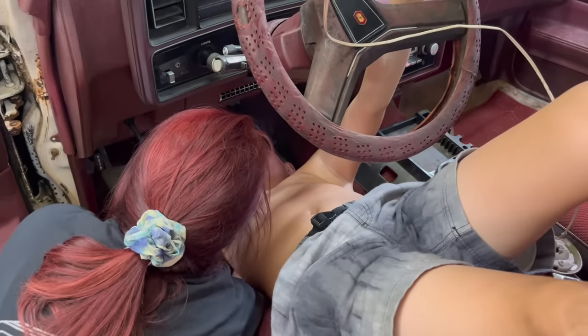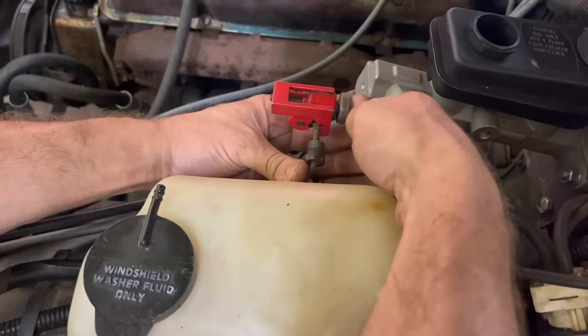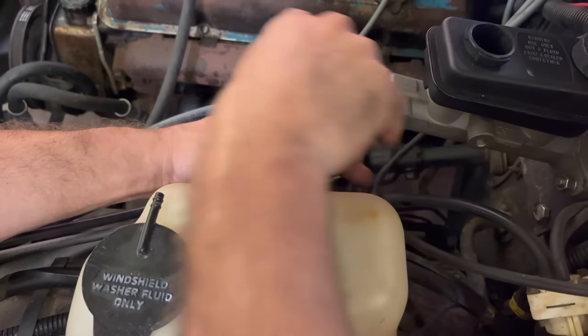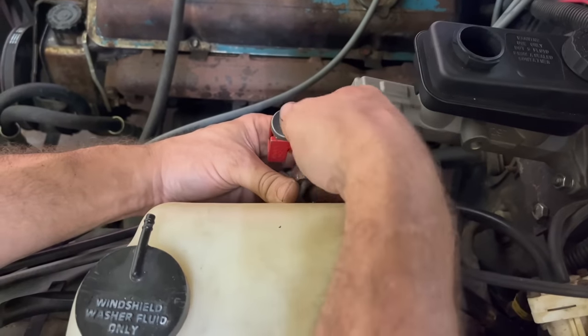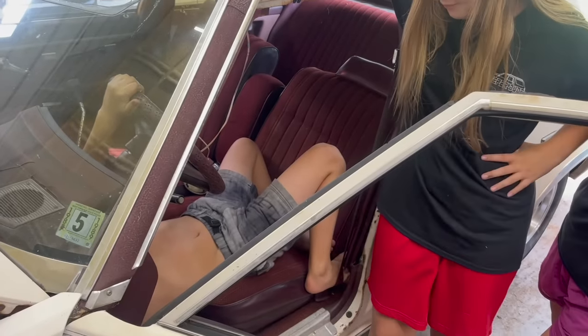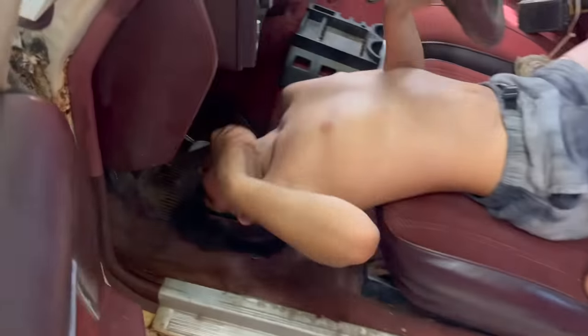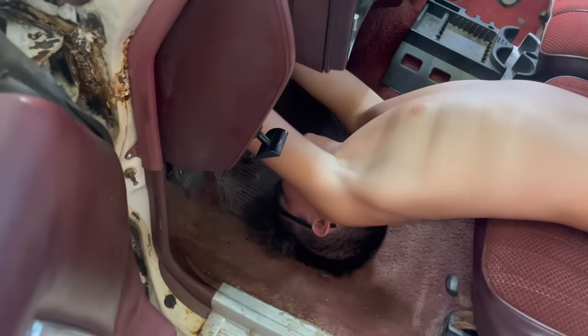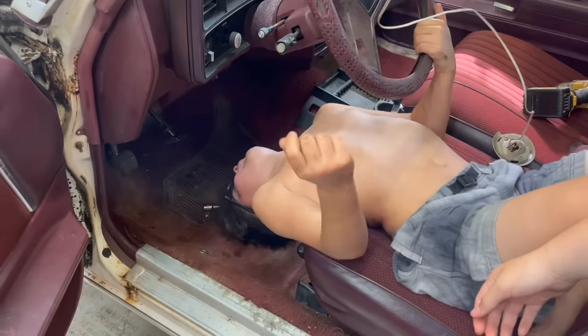This has a very big size tube nut on it, so we're going to have to cut this off and reflare it with a smaller nut that fits this master cylinder, while the three stooges work on the master cylinder mounting. Bumbo, how many you got on there? One! Somebody else has got to do this. This has been 30 minutes — I'm going to kill you!